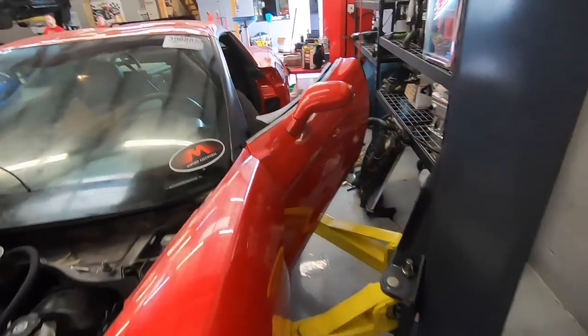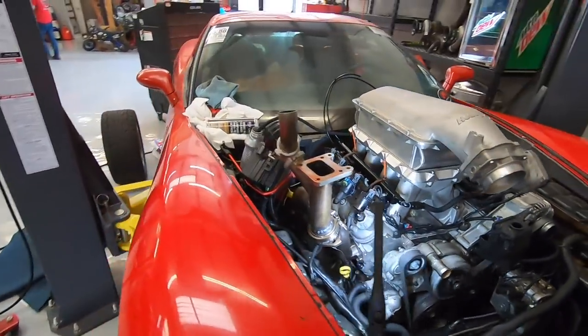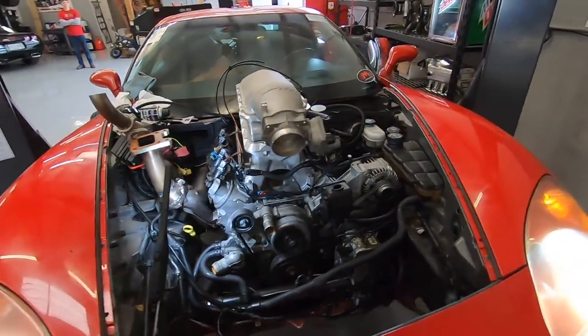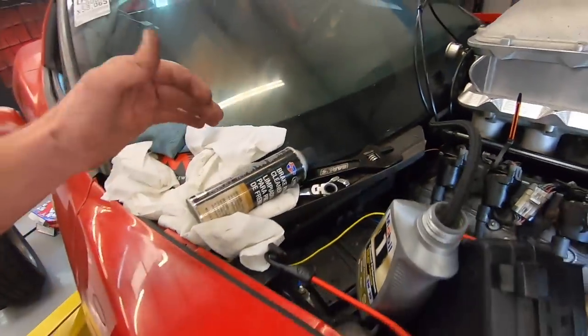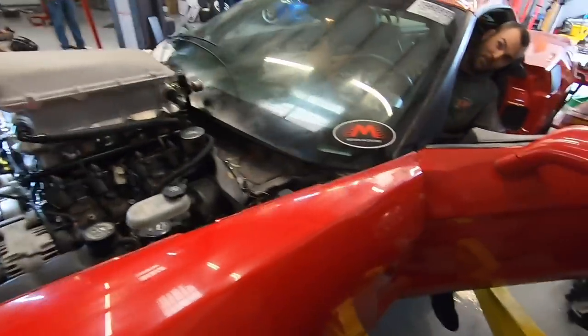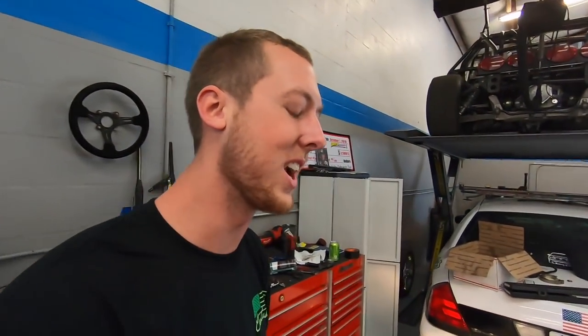Got oil pressure? Yeah, I saw there's oil in the quart. Like 65 PSI. Woo! All right, let's run it for just a hair longer. RPM, it's got 70 PSI. 70 pounds of oil pressure. Woo! Whole bunch of crap flew out the exhaust when it fired up.